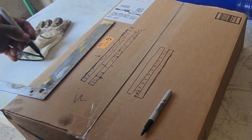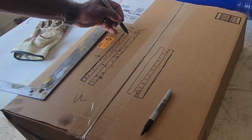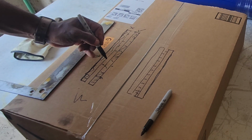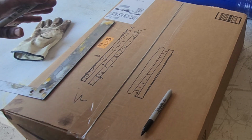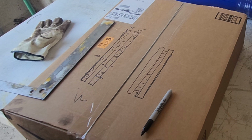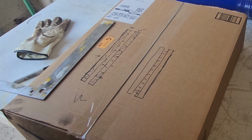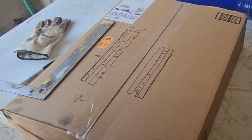Well, the problem is that now you have areas where it's thick and areas where it's thin, and thick and thin and thick. This is thin, and now the problem has become exaggerated, because now when you first get your rotors cut or lathe, whatever you want to call it, they drive smooth and they work perfectly fine.